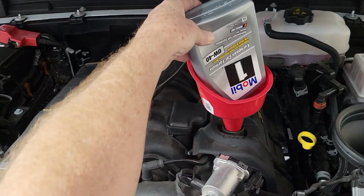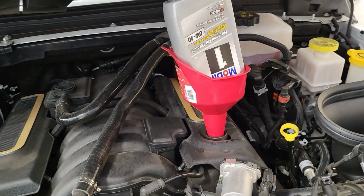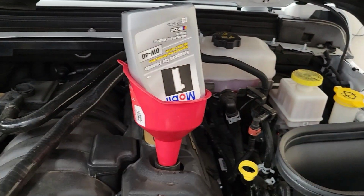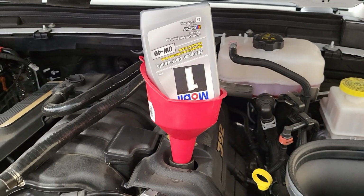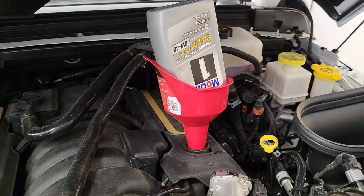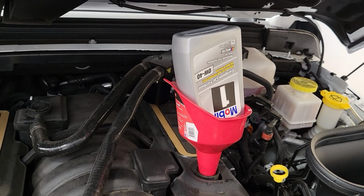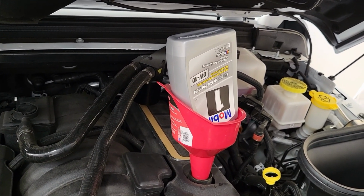As your oil drain trickles down into just a thin line, you're almost through. At this point, I like to add half a liter of your new fresh clean oil into it and let it drain an additional 20 minutes to half an hour. This ensures a total flush should you be changing oil types, and if there's any chance of getting small little chunks or anything else out, this will do it.